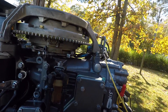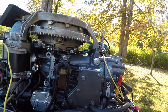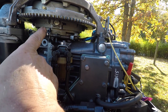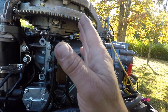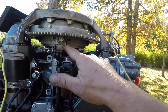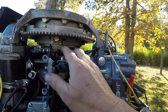So then what you do is this plate — rest it right up against here and then lock it down. Then when I go back to my idle position, this screw is going to adjust that plate, move it. If timing is off a little bit, we're going to set the idle adjust with this screw and jam nut to be three degrees before top dead center.